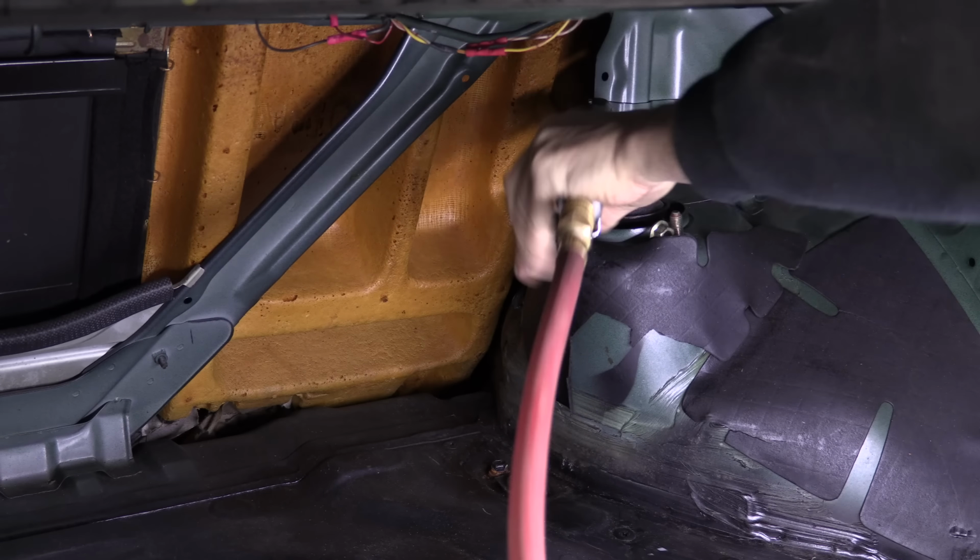2 long ones on top and 2 shorties on the hog's head. I mean diff housing. Sorry, my roots got me there. But I'm not pulling those shorties all the way out yet. I'm just breaking them loose while the 17's in my hand.